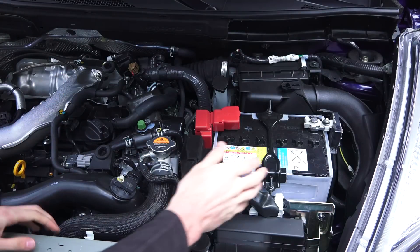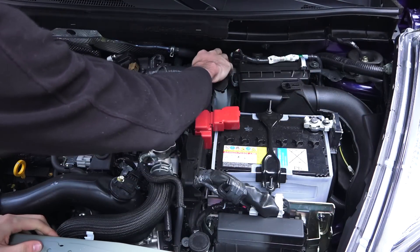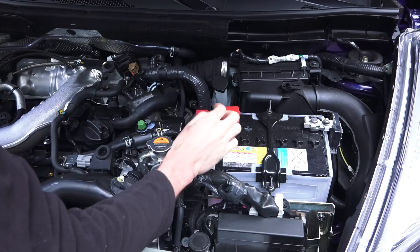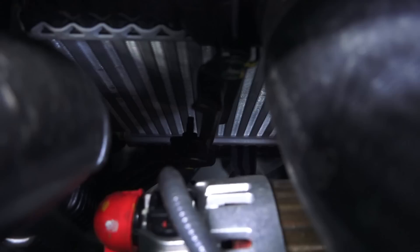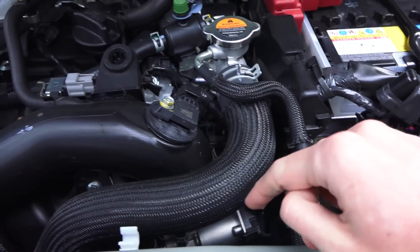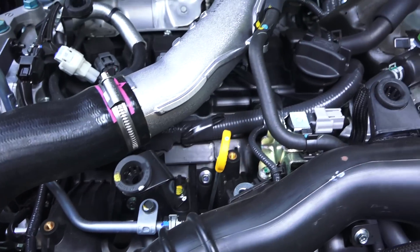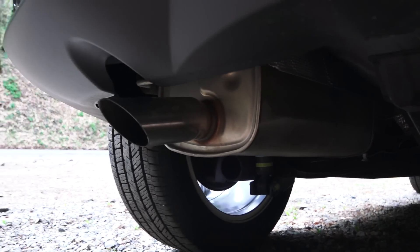Following the path of the intake air: it's first fed in from the right, passes through the air filter, travels into the inlet of the turbocharger, then passes back towards the front-mounted intercooler. It travels down through the intercooler and then back up where it is routed to the electronically controlled throttle body, then passes into the intake manifold. After passing through the cylinders it exits through the exhaust — single exhaust all the way back, exiting through a single tailpipe.